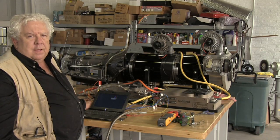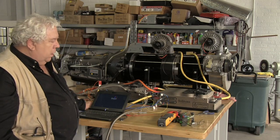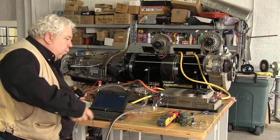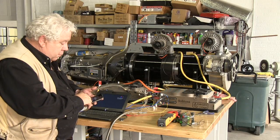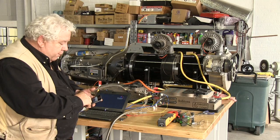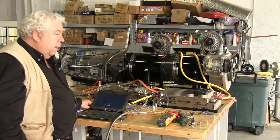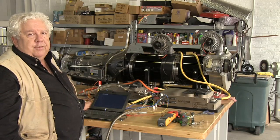Well, that is kind of interesting, because I do know, for example, if I had a 190 volt pack, that, well, let's see here. If I do the math, it's pretty easy to work out. I don't really statically want to go below about 3 volts. And so let's use our magic thing here. 190 divided by 3.35. Yeah, that's 57 cells. 57 times 3. If I set that at 171 volts, then I can disable the controller, essentially, when the batteries get down to, let's say, 170 or 168 volts, and prevent damage to the vehicle.